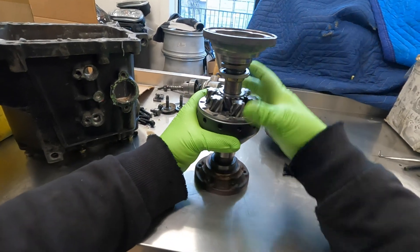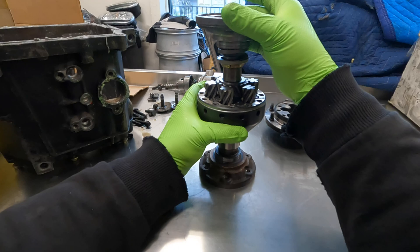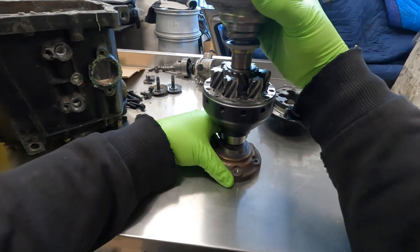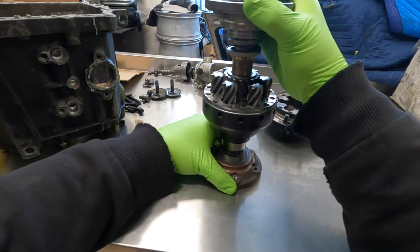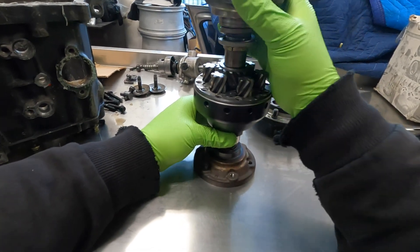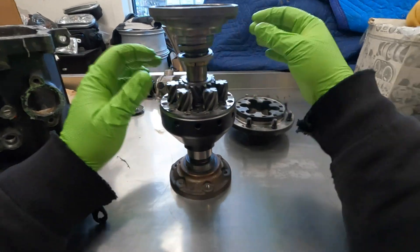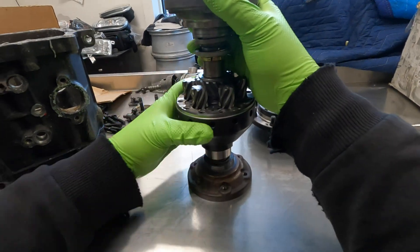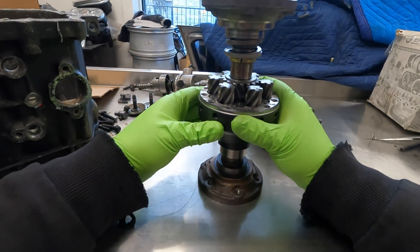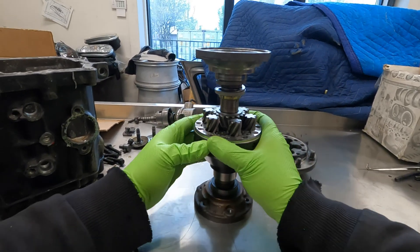The slight difference in wheel speed based on forces the road puts on the wheels — transmitted back through the axles — is allowed. But if you are accelerating really hard, in one direction the spiral gear wants to force up the center piece, which hits the housing and can't go anywhere. That's when the wave center piece gets into action to try and couple the two together, limiting how much difference in wheel speed there can be in extreme situations.